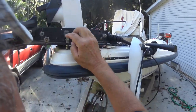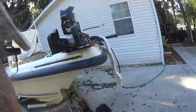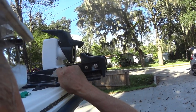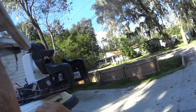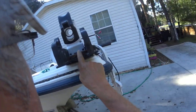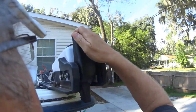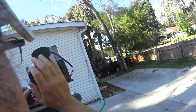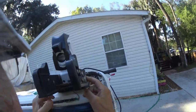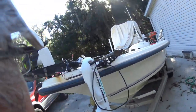Okay, so I've made my own stop. Keep this pin from moving out. Over on this side, this is to keep this from rubbing up against here. So I've also made a few alterations myself. And this pin right here, I keep having to put grease on it because this pin was way too soft. When it comes down to lock the head in place, the pin kept on bending, so I put this bolt in there. I've made some modifications of my own, and it just works better.